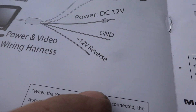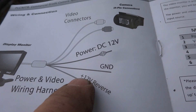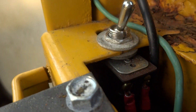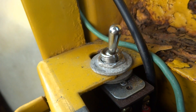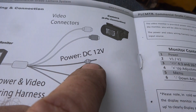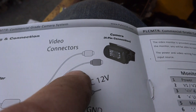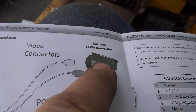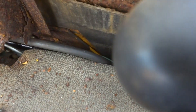Let me show you how I wired it — it's all underneath in there. Basically the way it came, there was a black line — that's the power for the reverse. I just used that switch there. See the two wires going down there? When I push that forward, that's going to say I'm going in reverse and this will light up. I also hooked 12 volts up directly, and then the ground to the ground and the connector to this rear backup camera. It's a 50-foot cord — I just kind of wrapped it up inside there.